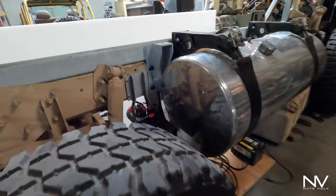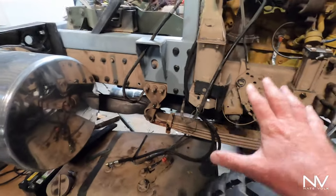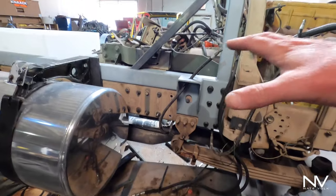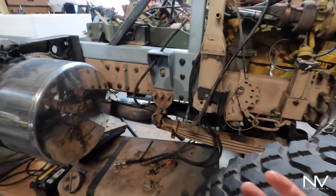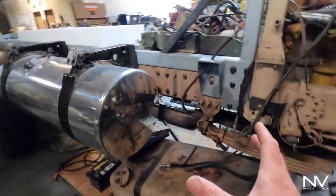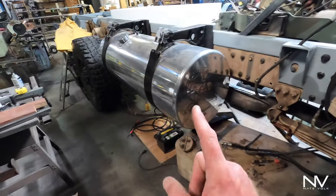I hope I did the math right — we'll see. I've got to sort out where I'm going to put all that and find a hydraulic manifold that I like. Up here in this area is going to be my generator box, and I'm not quite sure how I'm going to mount that yet. I really don't want it hanging from the floor because the generator is going to have some vibration — I'd rather have that isolated from the habitat. If I can't do that, I'll hang it from the floor and do a double vibration isolation scheme inside. Here's the old fuel tank — if anybody needs a stock fuel tank let me know, it's dirty but it's in good shape, I'll clean it up. And there is the big fuel tank.